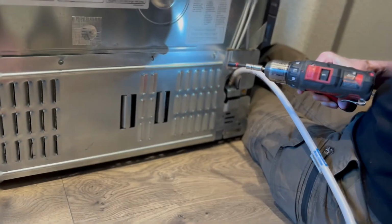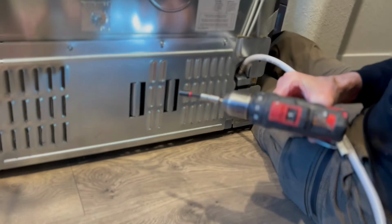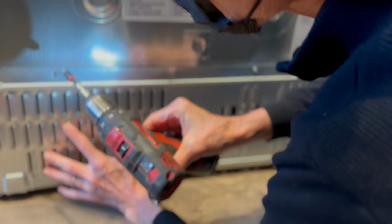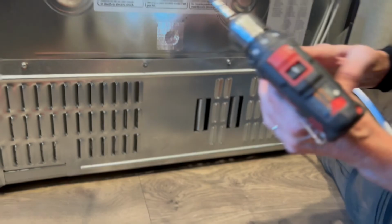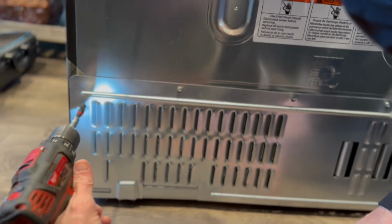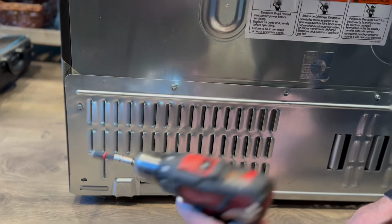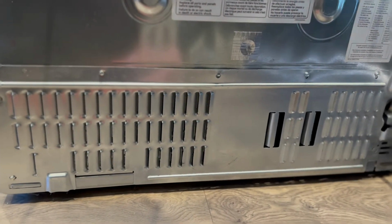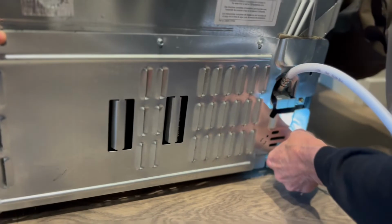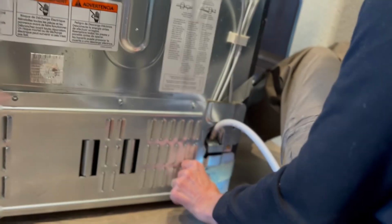I think the most common problem that I see is one that's iced up like this refrigerator, or one where the high limit that plugs into the compressor that we saw earlier has blown, and you just have to replace it. It's usually only about 20 bucks from Amazon for the combination of relay and high limit, and it's pretty easy to do. It's just a matter of pulling off the old one and putting in the new one and putting a couple of wires on.